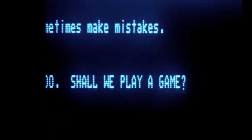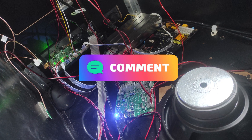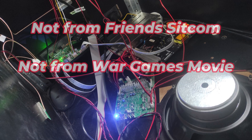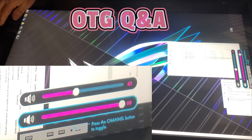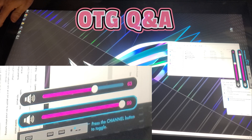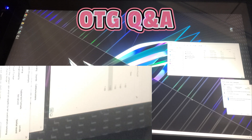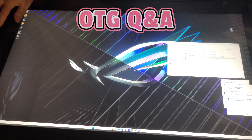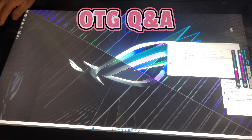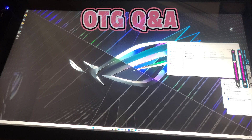Using the codename of Rachel for the VIBS board as an example, comment below with your guess as to the codename for the SSF kit. Hidden clues will exist throughout this series and revealed at the end. One of the questions from part one is how are the haptics? There are two haptic speakers built into every 4KP machine and they work very well over OTG. To adjust the haptics, press one of the volume buttons, then the channel button, and you can adjust the haptic strength. Another question received: does the 4KP disconnect OTG after some period of time? On the ALP-HD, it would seem to disconnect OTG every five to seven hours, requiring a power cycle. However, I've not restarted this machine in a few days and it's been stable — I can't guarantee that's the case, but I'm not seeing any disconnects.